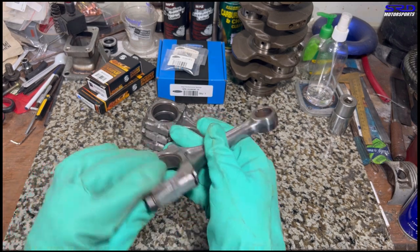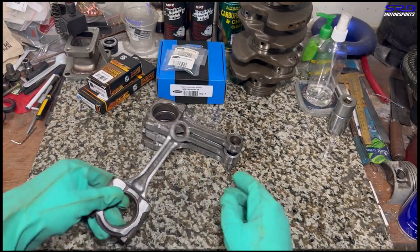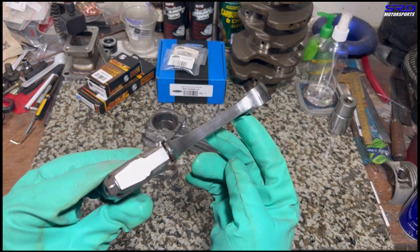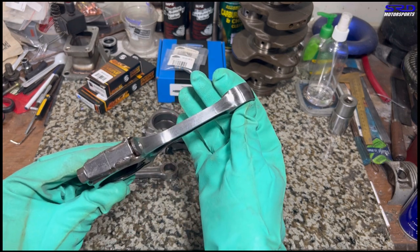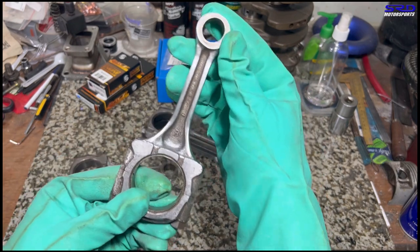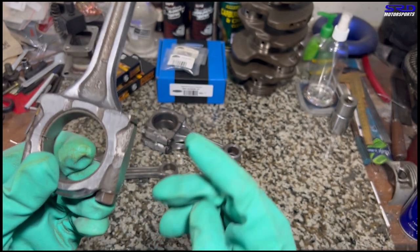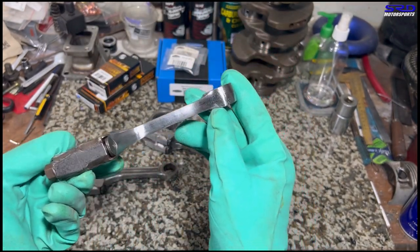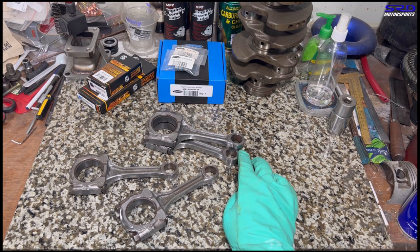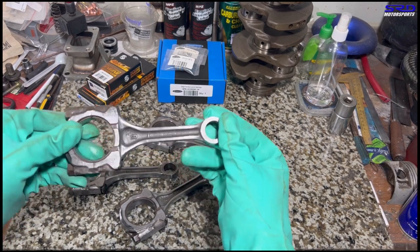You can see we got it fully polished to a good shine. We marked each rod and cap with a number — in this case number four — so when polishing I won't mix and match them improperly. You can see the beam is polished, with all the wrinkles and stress risers removed that could lead to future cracks or weaknesses. Without even carving much on the rods, this actually saves us 70 to 80 grams — that's a huge saving.